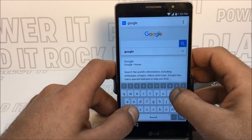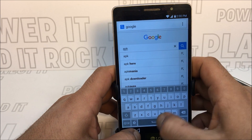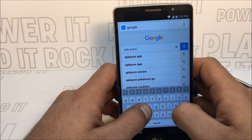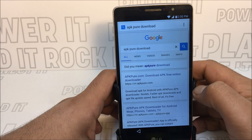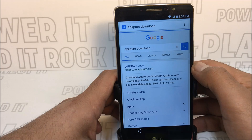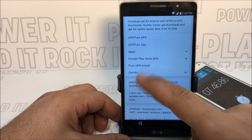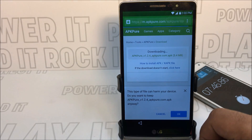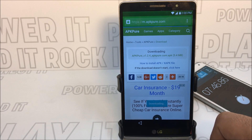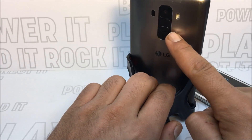Press overview and go back to Google Chrome. Search for 'APK Pure download' — type in 'apk space pure space download.' This is basically a marketplace for downloading apps. Once you type that in, press on the result that says APKPure APK download or install. Press 'Download APK' in the middle, press OK on the prompt, and it should download quickly. Now we have it in the file manager.